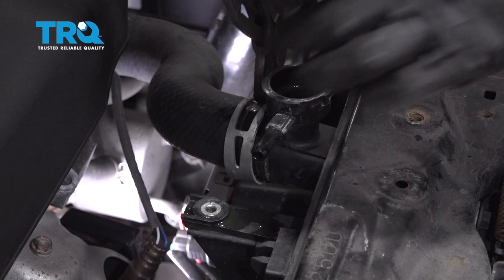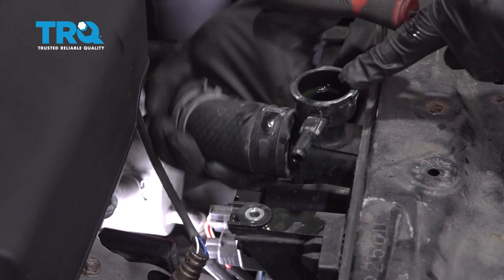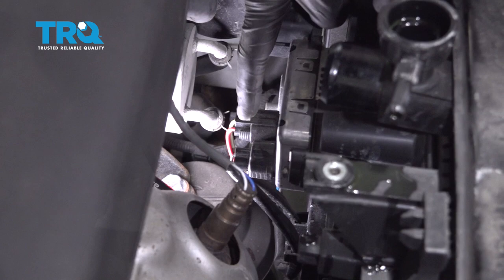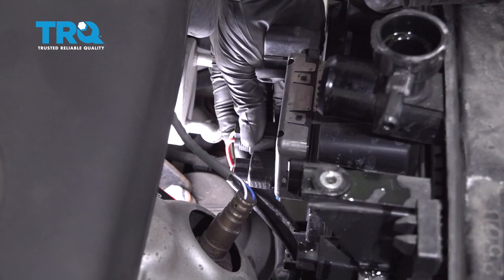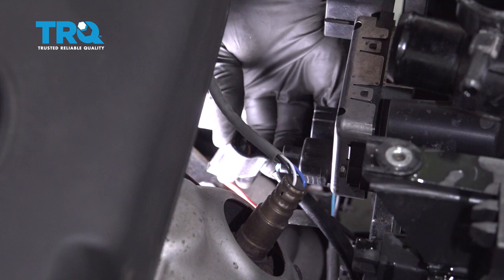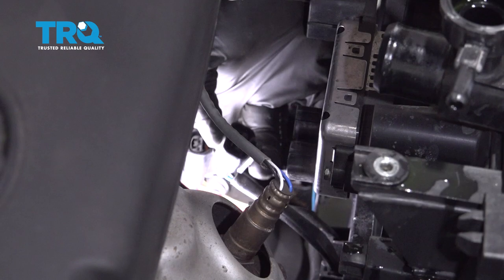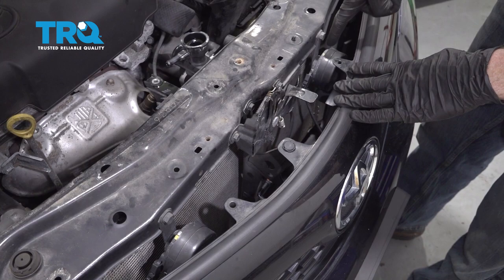Let's remove the upper cooling hose. Squeeze on the clamp, slide it down the hose. I'm just going to use a pick to break it free, slide it off of the radiator, and set it aside. Next, we're going to move along to removing these wires right here. There's a tab on the bottom that you're going to squeeze — reach underneath, squeeze on it, and remove it. Do the same to the other one. Once they're off, inspect them for corrosion. These look great.